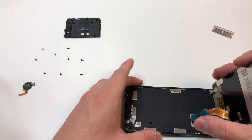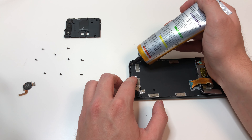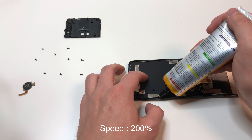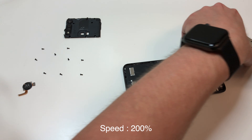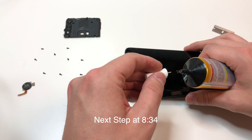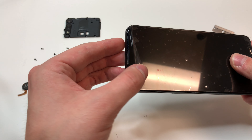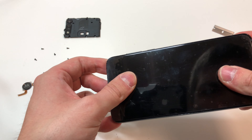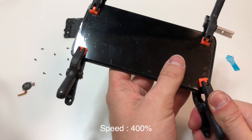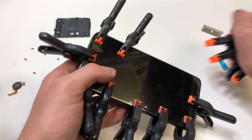Put the screen on by feeding the cable through, then add some glue around the area of the screen — be careful around the front camera or else it could damage that. Add just a little bit on the top, all down the sides, and all down the bottom. Then plug in the screen and push down the little cable. Put five clamps on the right, five clamps on the left, and one on the top and bottom. Motorola phones have difficulty gluing, so I recommend leaving this for at least two hours. Once that's over, take off the clamps and clean up the sides if you want.